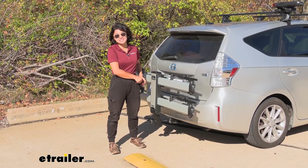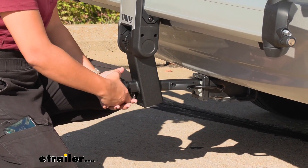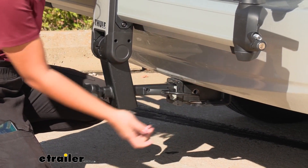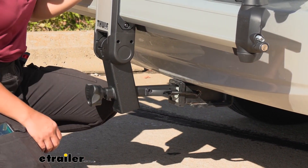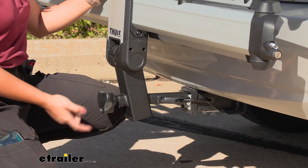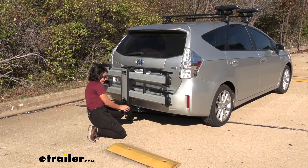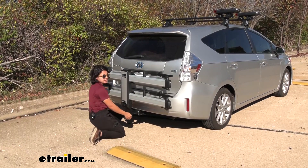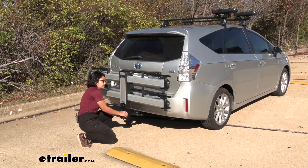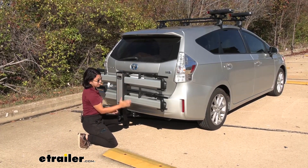This does not need any tools. You just have this knob which can be locked. With it unlocked, this tightens down inside that shank. And you also have this stinger here — when you pop it into your hitch, you just pop that stinger in and it's secured. No bolts, no extra pins that you have to line up, just that knob and lock it. Most bike racks with inner-core shanks and an adapter have an anti-rattle bolt which takes out the side-to-side action but not the up-and-down action. For the Helium, whether it's up and down or side to side, it's a secure fit. Something to be mindful of is that your trays may move a little bit while your bike rack itself is solid.